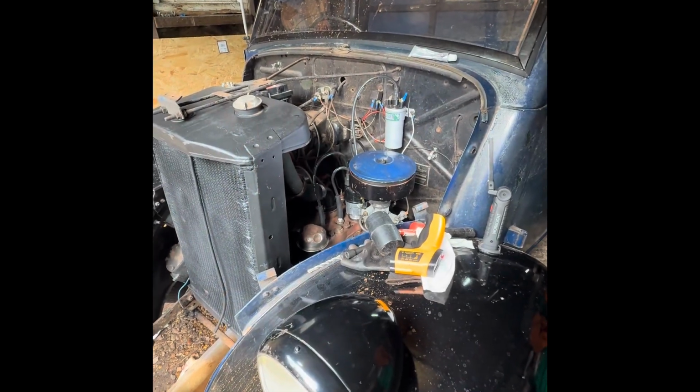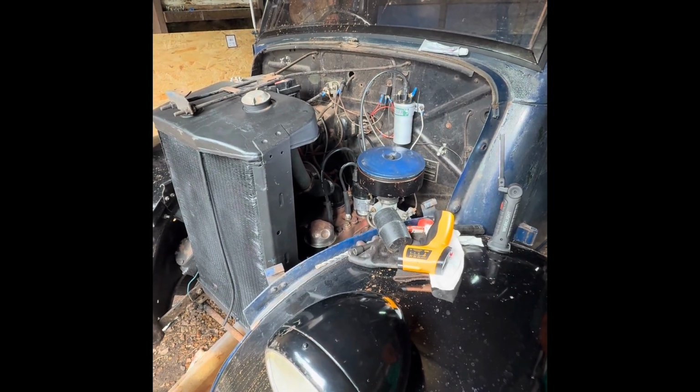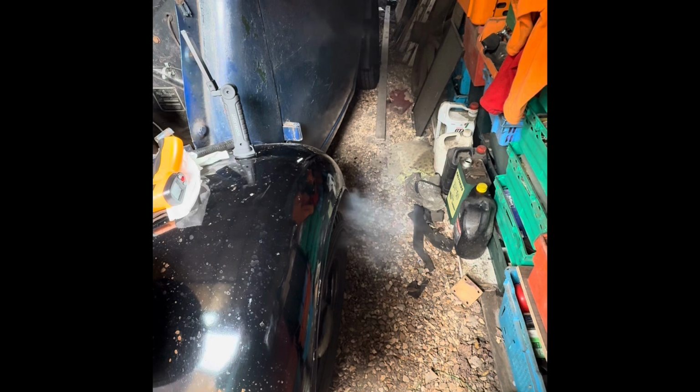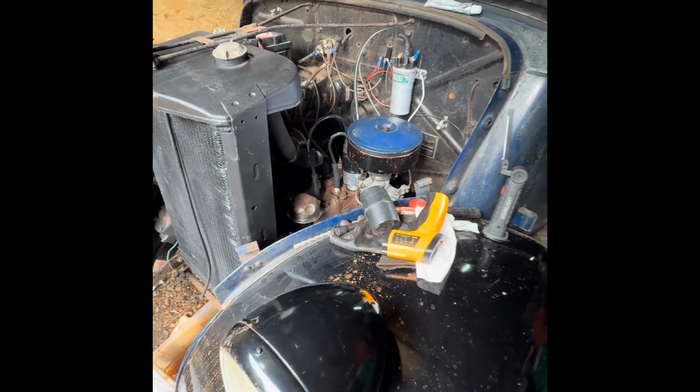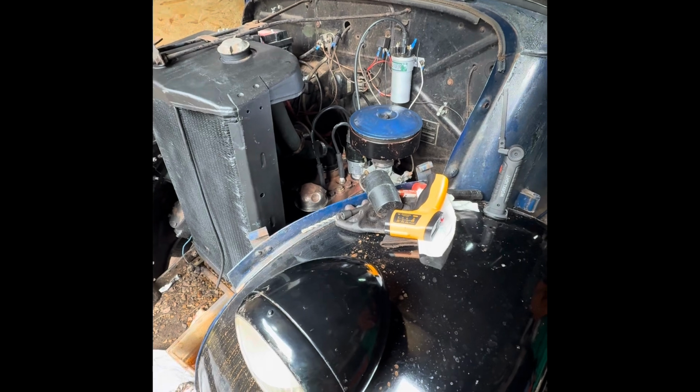She's running. Has been for probably about 25 minutes, half an hour now, just ticking over. Everything seems to be fine and dandy on the coolant side of things. But all of that is coming out of the crankcase breather. I know she used to breathe a little bit, but I don't remember it being that bad. According to the heat gun I got, cylinder number 3 not doing very much at all. So maybe that's where our blow-by is coming from.